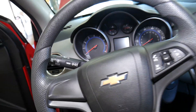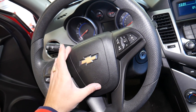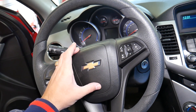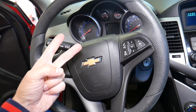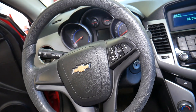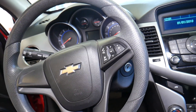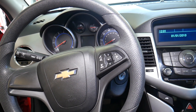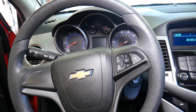I'm going to prove something now. Something you should never ever do: every time you work on your airbag system, disconnect your car battery at least one hour before the repair. And if you're not certified and qualified, do not work on airbags — they can kill you or your passengers. Be extremely careful.